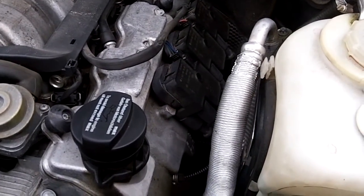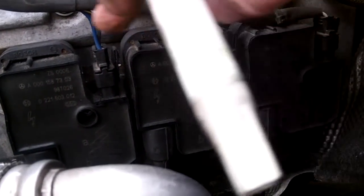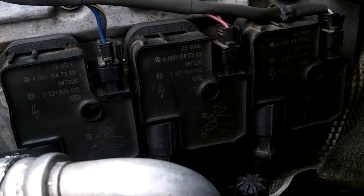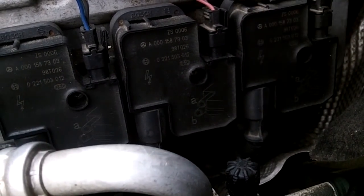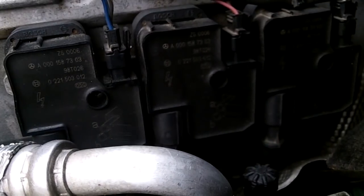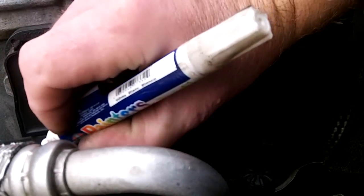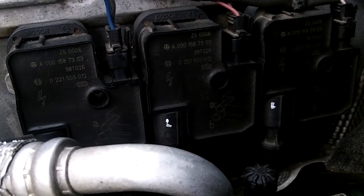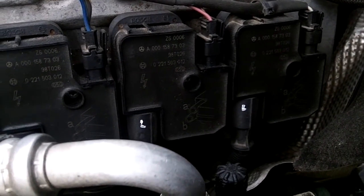We're going to mark our plugs before we move the coils. There are three coil packs, and each coil pack controls two plugs on each cylinder. It's marked A and B on the coil pack, but I'm going to mark them anyway — the top one goes to the left plug on that cylinder, the bottom one to the right-most plug. I'm putting an L on each of these just in case, because I'm going to be pulling the coil packs off and you're never going to get past them if you don't.